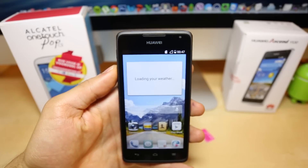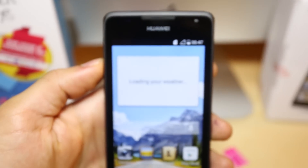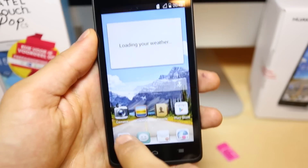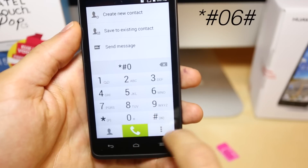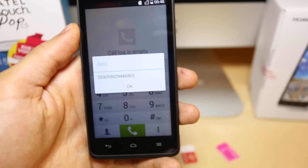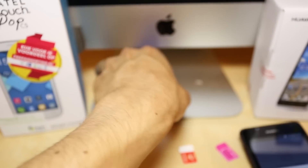So just make sure you have your phone ready. Turn it on, and once it's on, we're going to open the phone application just as if we were dialing a call. We will get the IMEI number — just type star hash zero six pound. The 15-digit IMEI number will appear. That is very important, and based on this number we're going to request the unlock code.